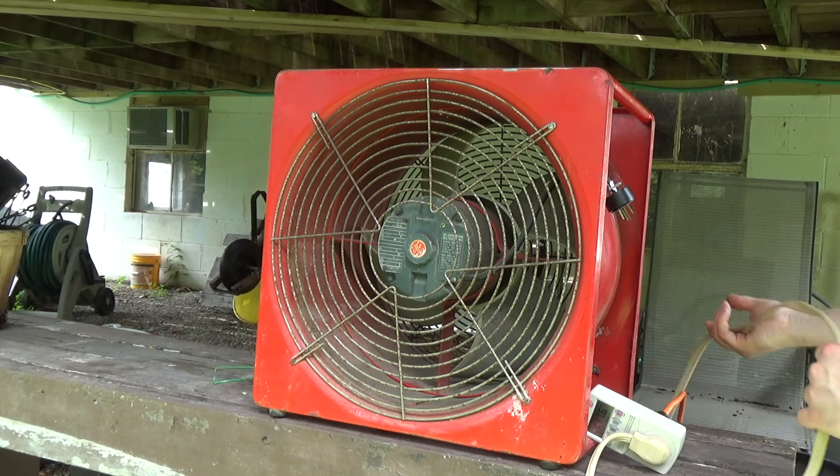I don't see what would go wrong. We only got 117 volts, so this might be on the wrong circuit — we'll see. This doesn't show inrush, but I'll keep an eye on it. It's drawing 6.4 amps — actually over spec quite a bit. 533 watts, power factor is 0.7.